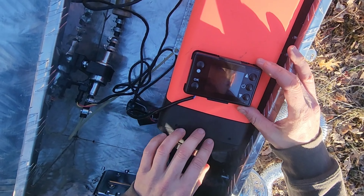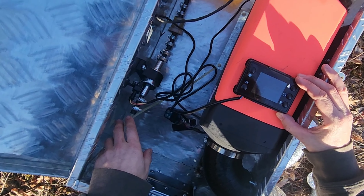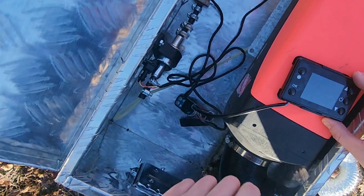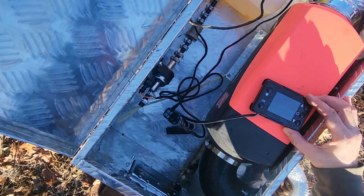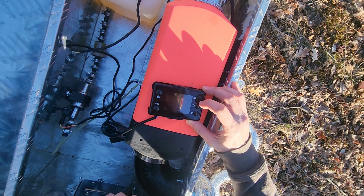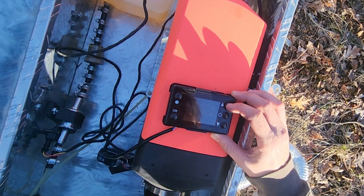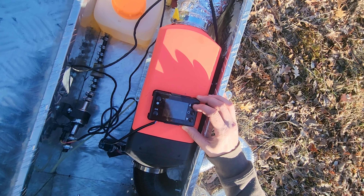Let me show you how this works. When you first set up the unit, you're going to have air inside the lines and you'll want to get that out. Press these two bottom buttons, then press the arrow to turn it on — you can hear that this pump has a prime feature, so it's pumping any air that may be inside the line out. Once that's done, just hit off, hit the on button, and you'll hear the unit start to warm up. It takes a couple of minutes before everything starts working, then the fuel pump turns on and it's good to go.